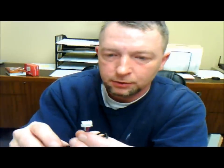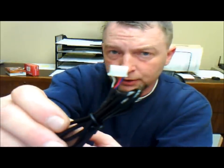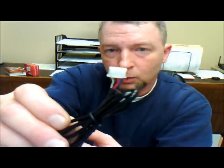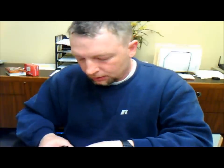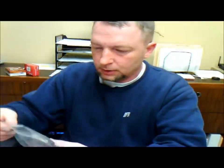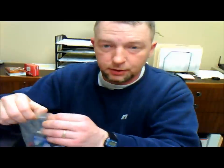The blue and red wire are still power and ground - that's never going to change. Then you've got the other two wires: one is your RX and one is your TX. In plain English, one is sending data to the bypass and the other is sending it back, so that's how it communicates from the alarm or remote start to the bypass kit. That's never changed - still the same. That information carries through to all the stuff I want to go through.